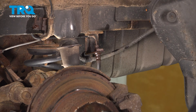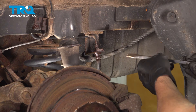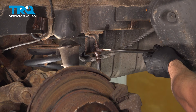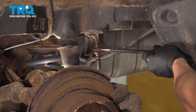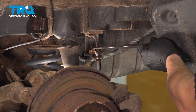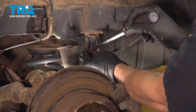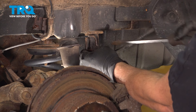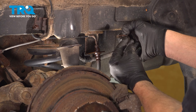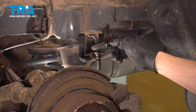Tighten that back up and wipe this down. The horseshoe clip is located right here. There's a flat upper top section to it right here, and we have a tool here that has a notch in it. We're going to come along the side of it and tap it with our hammer to loosen this. You can see it rotating and as we tap it, it's releasing the horseshoe clip. As you pry it off, remove it — and that's why we call it a horseshoe clip. It is arched, bowed on the top, so when you install it, it has a spring retention to hold the two together and onto this metal bracket.